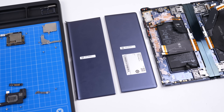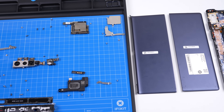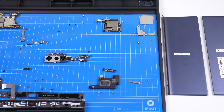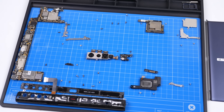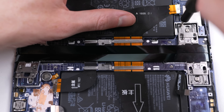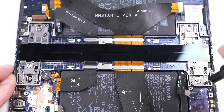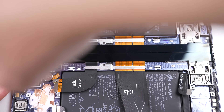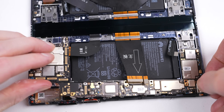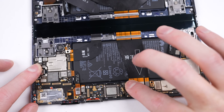We've now completely disassembled the Huawei Mate X. It's amazing just how thin they managed to get this device while still maintaining a large battery and expandable storage. However, removing the battery requires risking damaging the display while removing pieces of trim to access the cables blocking it. That's not to mention the lack of replacement parts — I couldn't even find any service options from Huawei themselves, making this several-thousand-dollar phone essentially worthless. Without a new screen to put on it, I'll just reassemble the phone as is. That's the major issue with foldables: the technology is just not good enough. Failure rates are still very high, and replacement screens can cost more than a brand new phone, making phones like these quickly become e-waste.